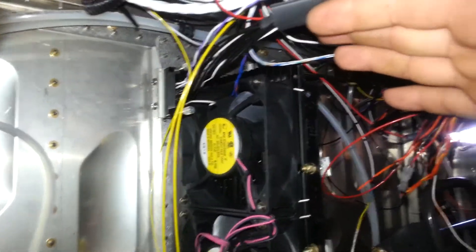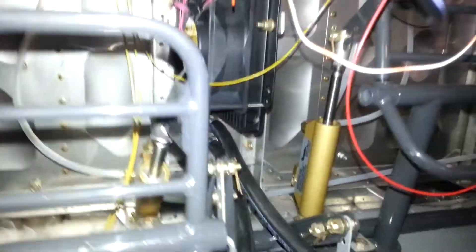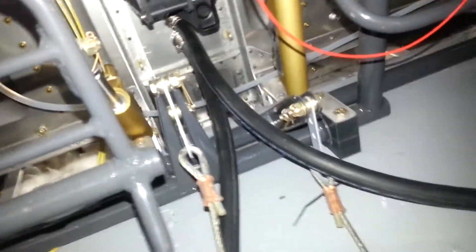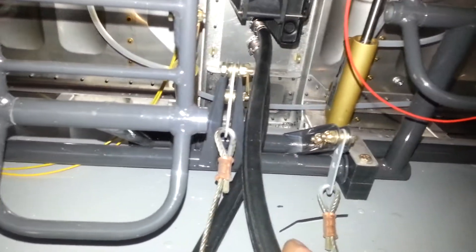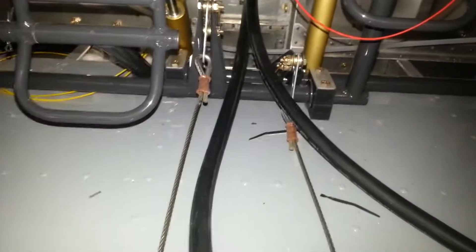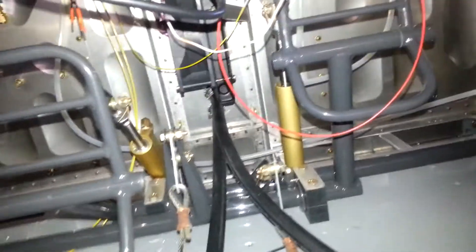What we are going to look at is the location of the heating system in the S19. In front of us we have the rudder pedals, and over on the other side we have another set of rudder pedals. In the middle there is a passage — not a very big passage, but big enough that we can mount two firewall pass-throughs on the bottom. Those will have our fuel injection hoses that eventually end up at our six-port fuel valve that we need for this low-wing airplane.